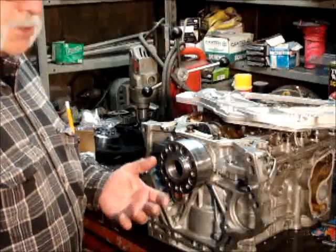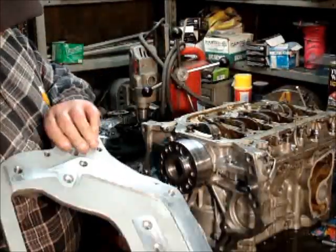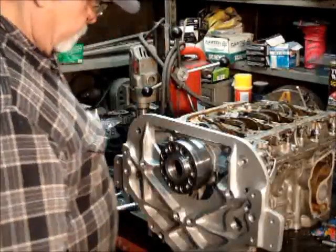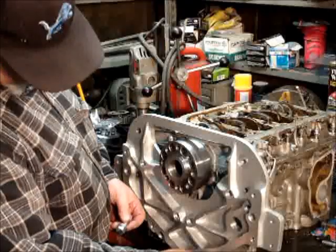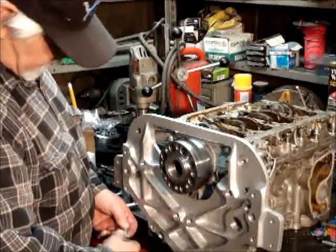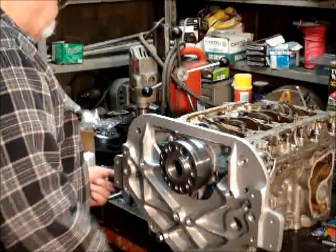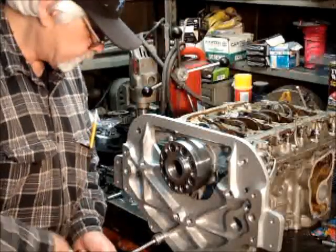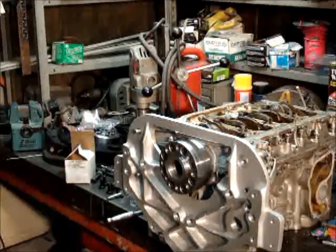I did this so that you could build this whole setup in 4 steps. So I built this adapter plate with the engine on one side, the transmission on the other side, right up in there flush. And then I provide these bolts, and I'm concerned with these top bolts because they are countersunk. I don't want you to put any lock washers on there, because a lock washer might put that head out far enough that it would bump into the transmission case. Set.